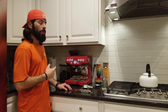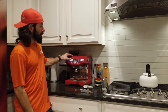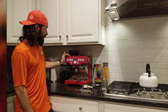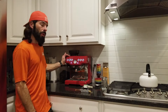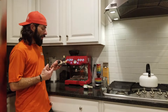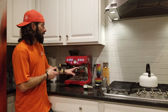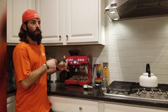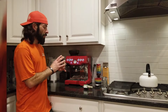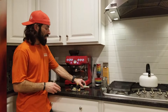That's music to my ears — the last couple weeks I've been running off of French press because the water pump failed on this guy. Normally that's the sound you hear when you start up the Barista Express by Breville, this is the 870 XL. A couple things failed on this one that we worked around for the last two or three years, including the solenoid block. We went ahead and ordered a new water pump and solenoid, and we're going to show you how to replace both.